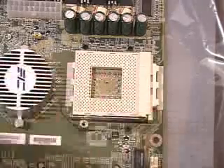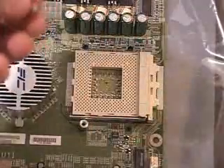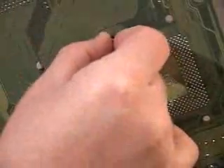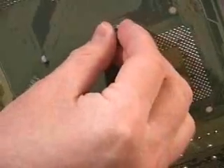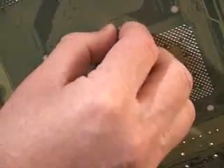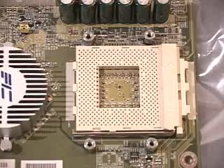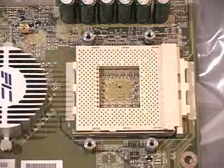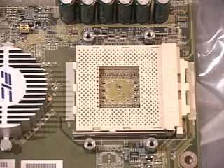On the bottom of the board, install the black fiber washer as well as the hex lock nut. You can see at the bottom of the motherboard you've got the standoff sticking through. Put the black fiber washer on over the standoff, then screw on the hex locking nut. Once all standoffs are installed correctly, fill the socket with dielectric grease, which is used to prevent condensation where parts are exposed to cold.